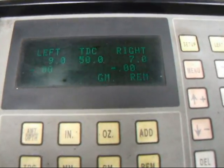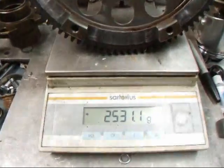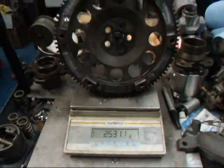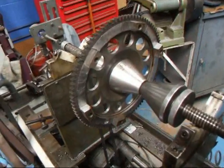As you can see, we have zero zero on each end, so this bad boy is now ready to go back on the bike and terrorize the neighborhood once again. As you can see, our final weight for this flywheel is just a little over 2500 grams. If you have questions about motorcycle flywheel lightening, give me a call here at Costa Mesa R&D — we'll see you soon.